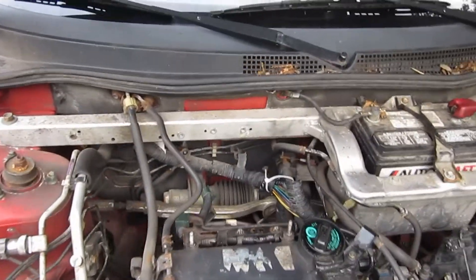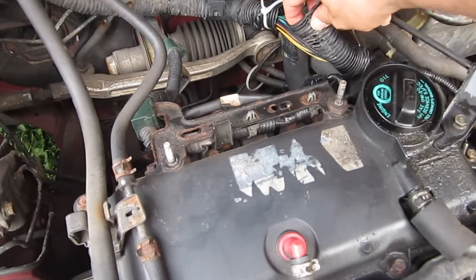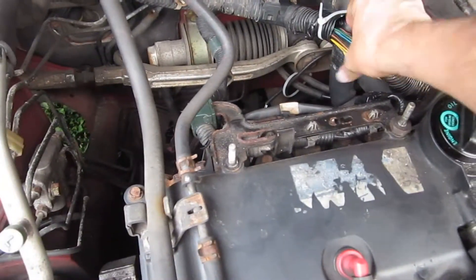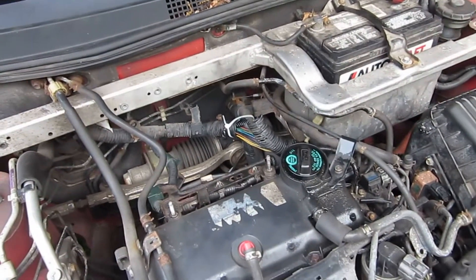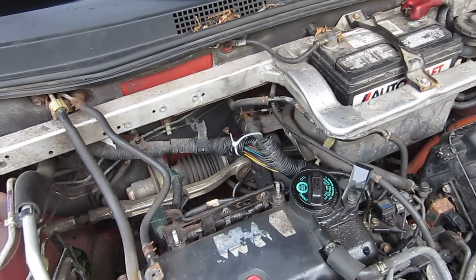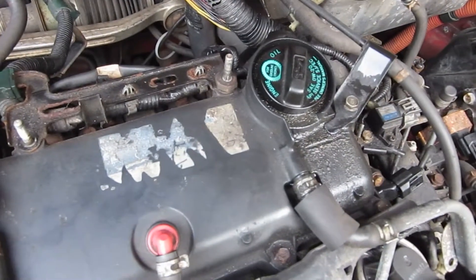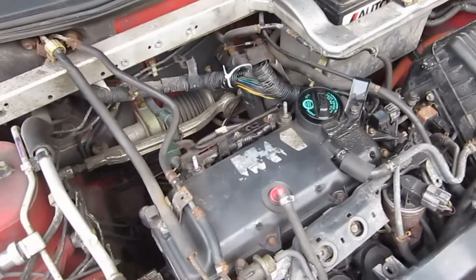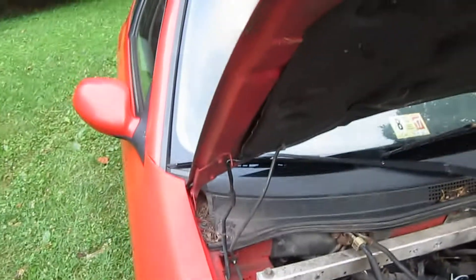I've been looking at these cables. I thought maybe this cable got really close to the catalytic converter, so I was trying to probe the wires in here because I was thinking I'm getting a catalytic converter fault. I tried replacing the sensor, and that didn't fix it, so I was thinking maybe one of the wires got broken because it looks like it burnt through the cable casing here. So I was trying to trace back the wires back to the ECU, and at first I thought they were maybe in the back of the car.